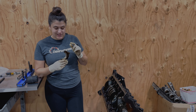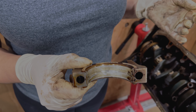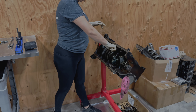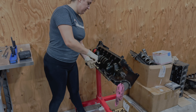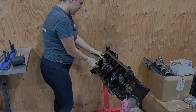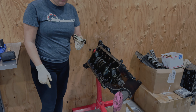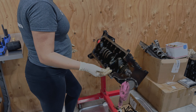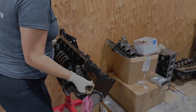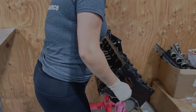I had some technical difficulties getting out number six. As you can see, this is a thrust bearing — I'm not going to pop it out because I'm not going to have the force to do so. What I also did off camera was take one of the cap bolts and put it back into each of these to knock them out so I didn't waste time. So this is one, two, three, four, and then number seven. I'm going to try and take this out, which I don't think I'm going to be able to, but it's worth a try.